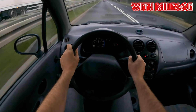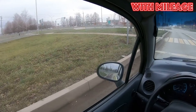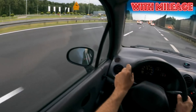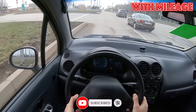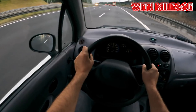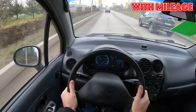The chirping sound of the three-cylinder engine, reminiscent of a motor scooter, initially concerned owners, but people quickly grew accustomed to the character of the 0.8-litre unit. The junior three-cylinder was developed together with Suzuki specialists. Despite its small displacement and low power, a resource of 150,000 km before overhaul can be considered very good. The four-cylinder 1.0-litre engine typically lasts 50-70,000 km longer before overhaul; cases of it withstanding around 300,000 km without major repairs are known, though this is the exception rather than the rule.